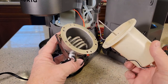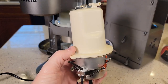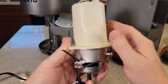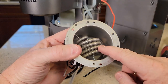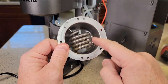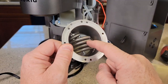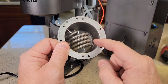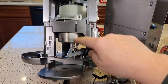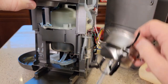Here I've got a water tank that was inside a Keurig K-Mini — here's what these look like. There's kind of a really hard plastic at the top, but the bottom is metal, and that's where the heating element is. So when we descale a Keurig, this is the part we're descaling, because you'll get mineral buildup in there — this is aluminum, and hard water deposits will form on it, so your heating element won't work as well. That's exactly what we've got here with this aluminum tank and hard top. It's a little different design, a little bigger, but same principle.